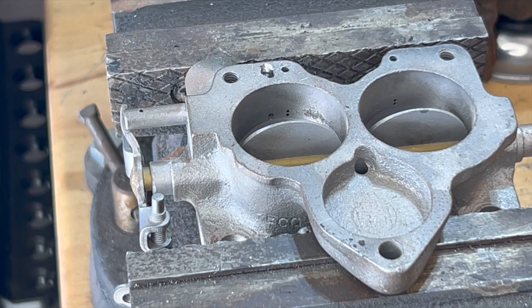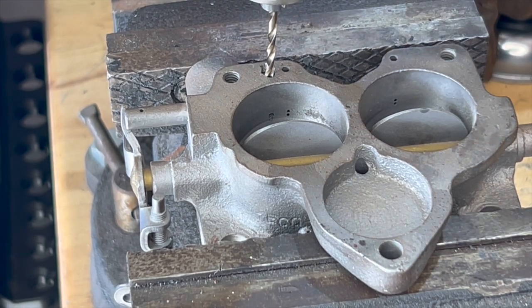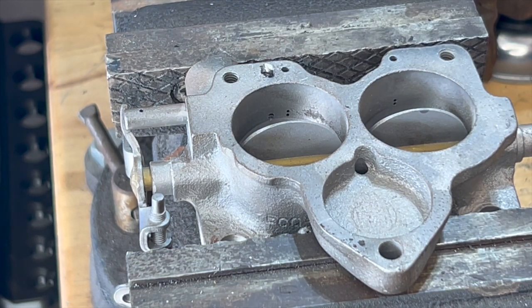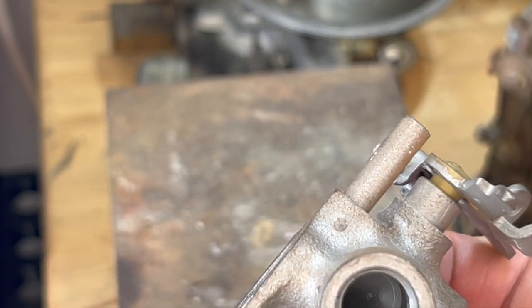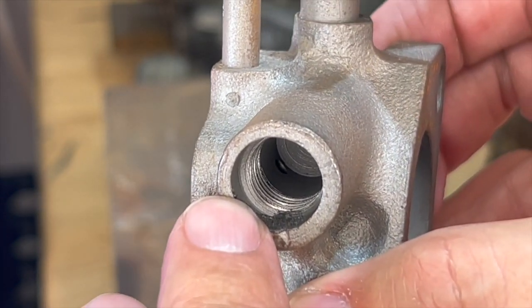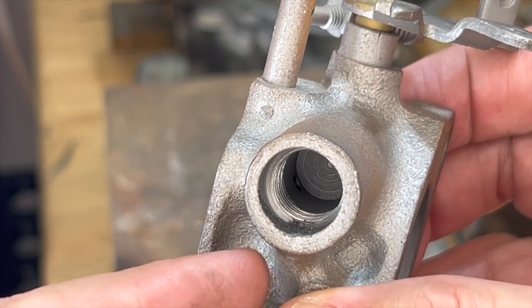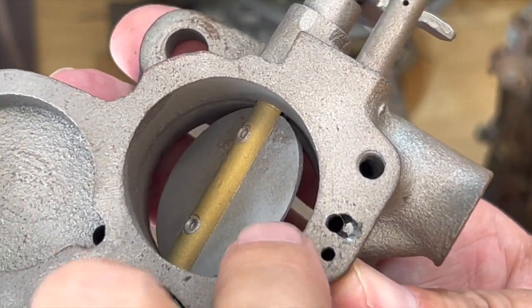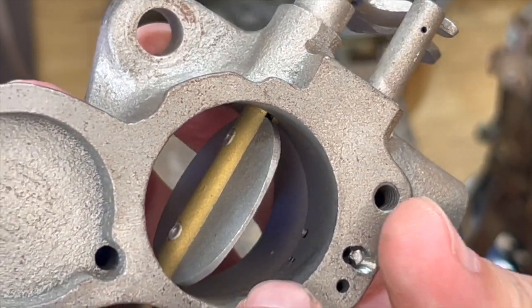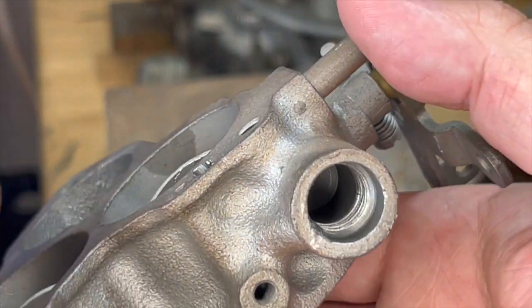Then we're just going to go straight down and make sure that we connect with that port. You can tell when you've made a connection here — you can see it coming out. You just want to make sure that we're right through that passage. We're going to blow it out with air off camera. Now that we've blown it out, essentially what we've done — if you look way down in there, you can see there's a port. We've sealed off the port that came past the spark control valve, and up here, after sealing that off, we've made sure that this port gives us ported vacuum all the way back through our brass adapter. So we're going to get a great reading for our 57 to 64 distributor now.